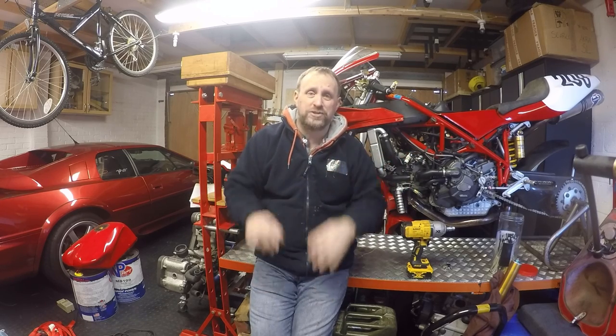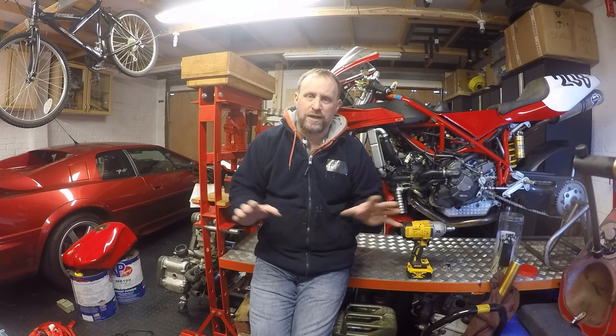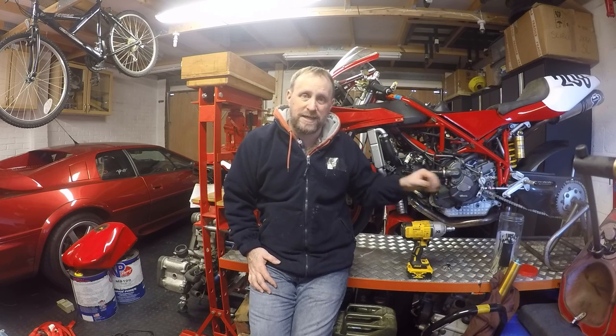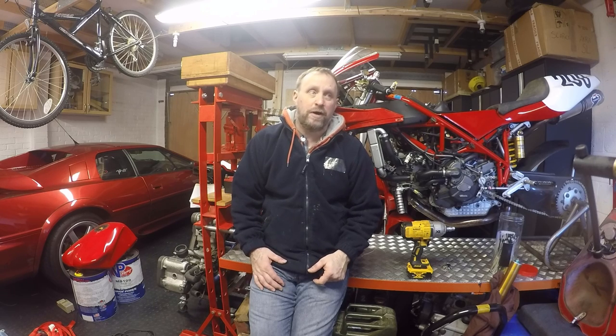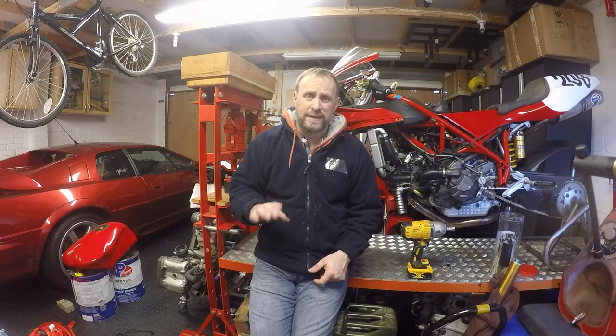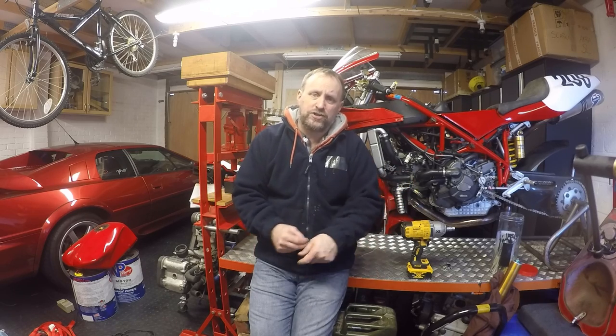Still a few little odds and sods to do, but nothing that I feel is worth filming because it's all stuff that you would have seen in other build videos of mine when I was putting the bike back together. So I've just got to top the oil up, put the rear wheel back on, stick the fuel tank on, and stick the bodywork on. I've got to dial in the settings for the suspension, but I'll do that when I get to track. And I've also got to top the water up, but with the cold weather at the moment, I'm going to leave that to the last minute as well, because you don't put antifreeze in race bikes, you just put water in.